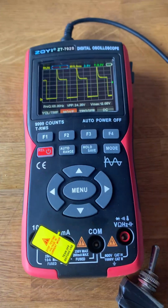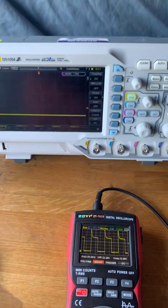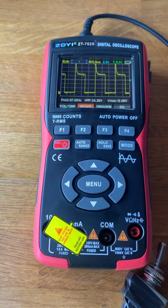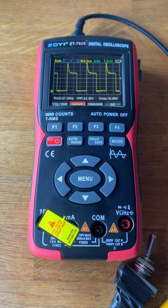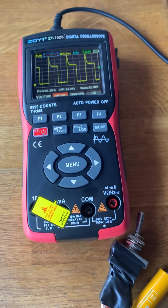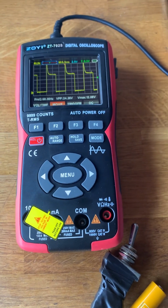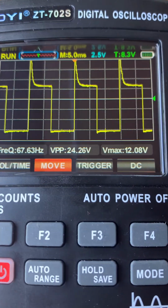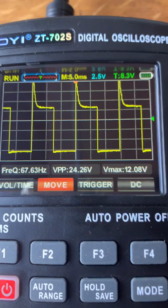So you can use a pretty cheap oscilloscope rather than that expensive oscilloscope to measure what the frequency valve is doing, and what they generally call setting the dwell. You're not setting the dwell. Dwell relates to the ignition, the points and the ignition timing, but they use a dwell meter to measure this duty cycle. What we're actually interested in is the duty cycle.